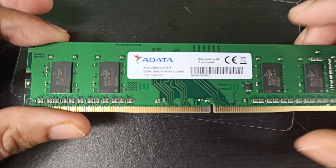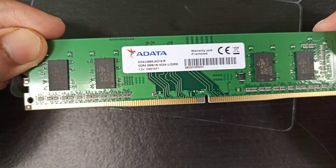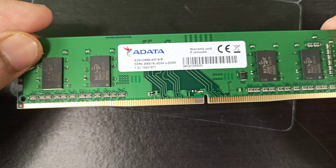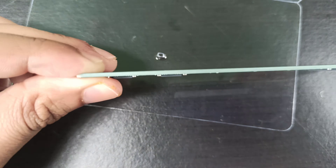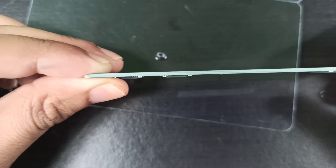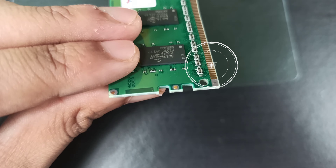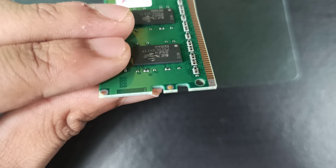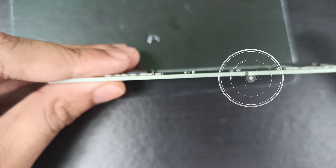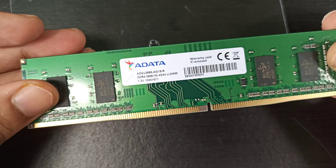The design of the RAM is also pretty neat and looks really decent. At the front there is a label which says 'warranty will be void if removed.' This is a DDR4 RAM, being two times faster than DDR3 SDRAM, and it has 288 pins — more than its predecessor DDR3 which had 240 pins. And here you can see the key notch.